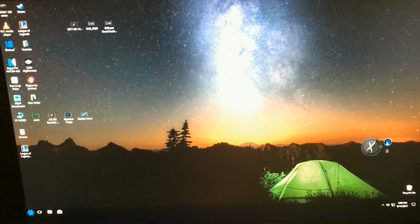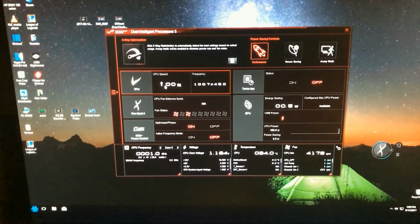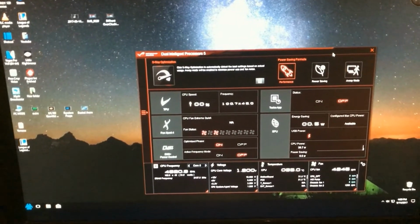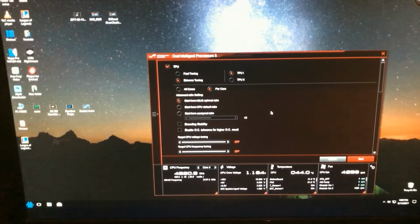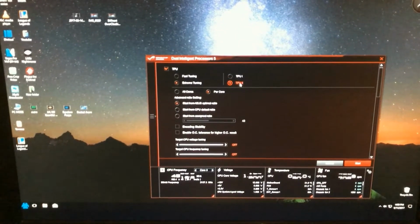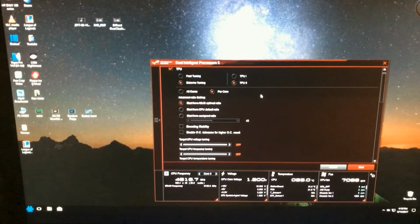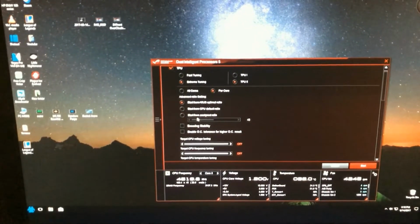I always forget it doesn't pop up right away. Okay, so we're at default. Overclock's at 0%. Now we've seen my manual overclock gets 19% at 5 gigahertz. So let's go ahead and run this. We're going to do extreme tuning, TPU 2. I may do two, one per core and one all core, but we'll try per core first.